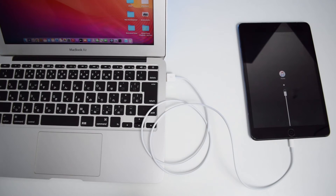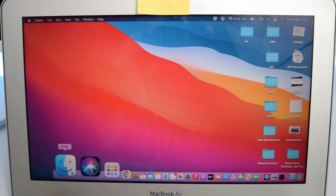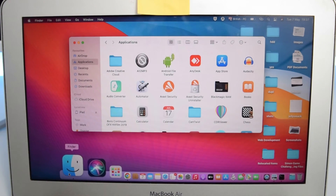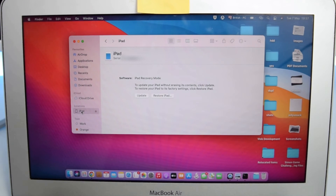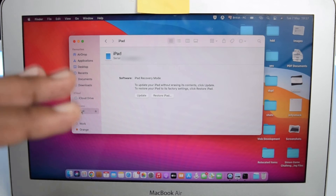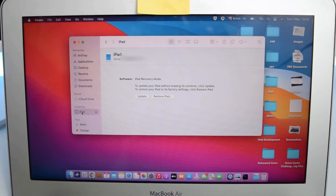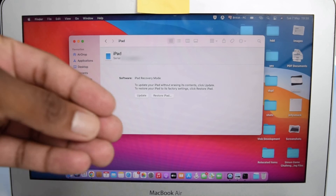Make sure you do not mess around with the USB cable — do not touch it, because you want to avoid any miscommunication during the installation process of the new operating system. Now, here we are on our laptop. If you've got a Windows PC or an older macOS like Mojave or earlier, you'll need to open iTunes. But if you've got a recent MacBook, you're going to open Finder, then tap on iPad in the left sidebar. This should be the same screen you'd see in iTunes.